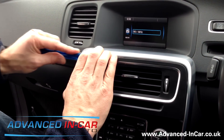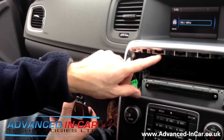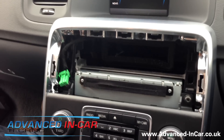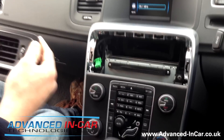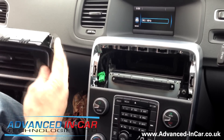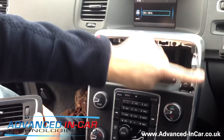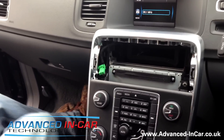That's when you can remove it — using your trim tools, get your top edge in. We found that these clips were very very tight. You can see they've got a nice plastic fitting to sit in here, and that's where they're very tight. The first time you do this you're going to be worried about breaking it. You've got to have faith — this is a Volvo, it's not a Ford. Well, actually same company, but you know, you've got to have faith in the plastic. It does actually work provided you're using trim tools, and as you can see there's no damage around the plastic fascia. Unplug and put aside.